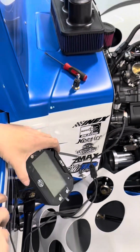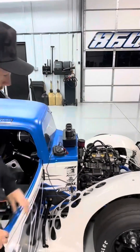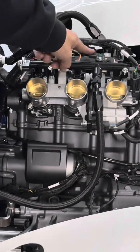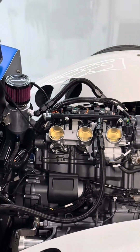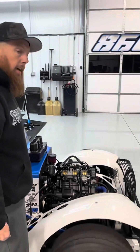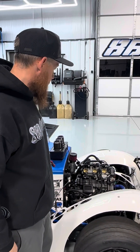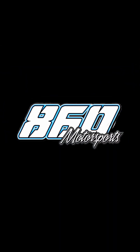Now you're going to start the car. Now that you have everything programmed, you're good to go. One note: make sure that your map sensor is plugged into the back one — it will not start if you're plugged into the front one. And that's about it. Pretty simple, easy to use. We ran it last weekend in Las Vegas — car ran great, zero pedal problems. I think the guys at US Legends really got this figured out. If you have any more questions or concerns, drop a comment. Appreciate you guys watching.